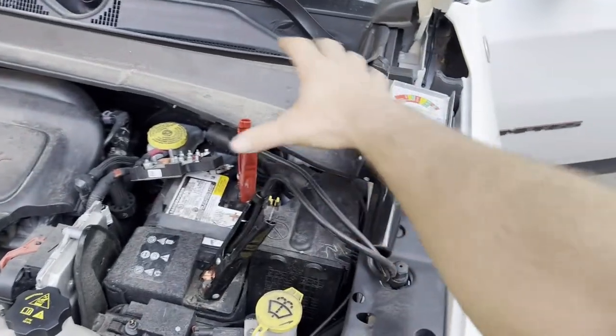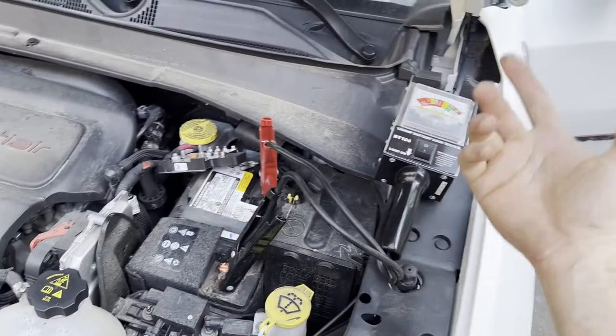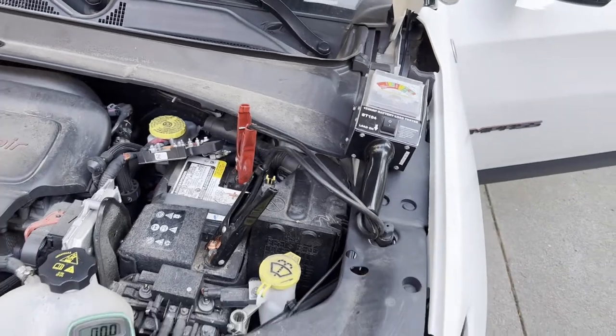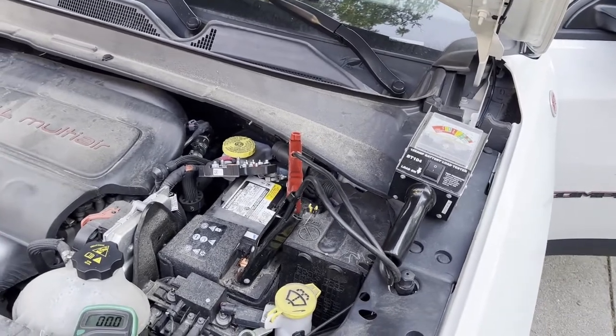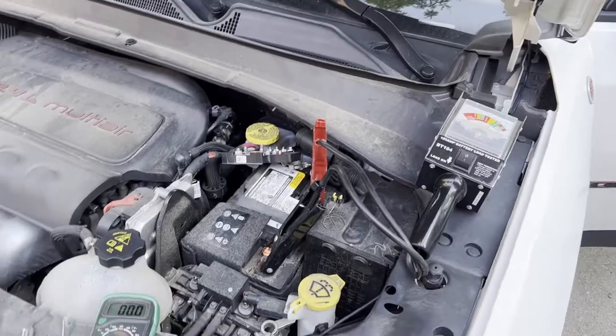There are several different options, but this is the most tried and true way: disconnect everything so there is nothing interfering, use an old-school analog carbon load tester, and just let her rip. I'll post a couple different options down below. Hopefully this video helped you guys figure out how to load test a battery — if it did, hit that like button, comment below with any questions, check out my other videos, and check me out on all my socials. Thanks for watching, have a great day.